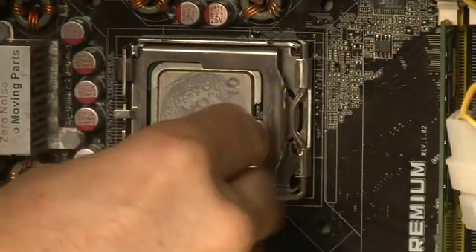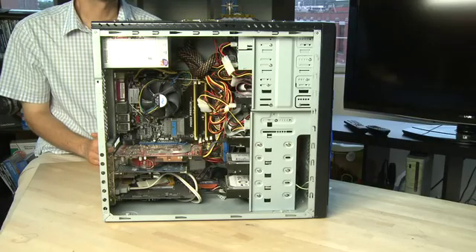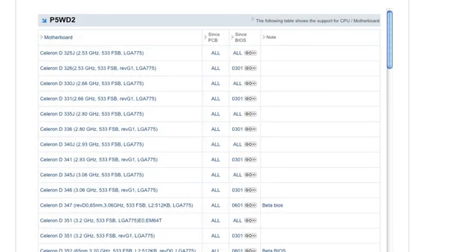This is something you want to be very careful about, and why you want to identify the motherboard — because the motherboard will typically take CPUs up to a certain speed, so you want to be sure that you match the specs of the motherboard with the processor you're planning to use. Sometimes you may already have the fastest processor that will go in that particular board.